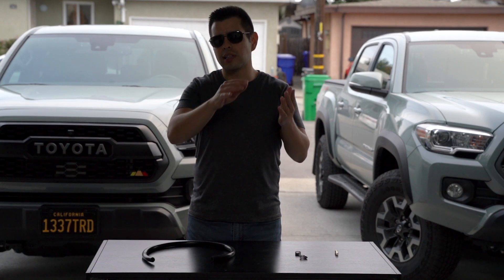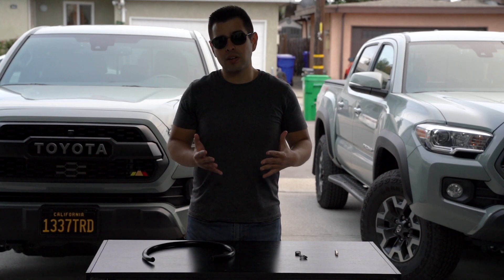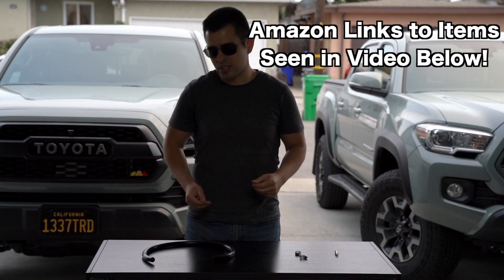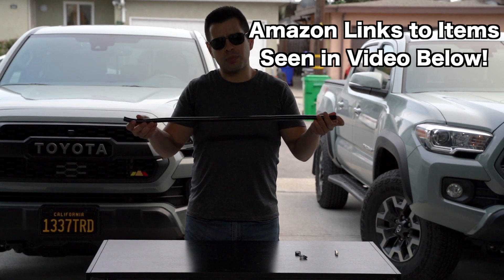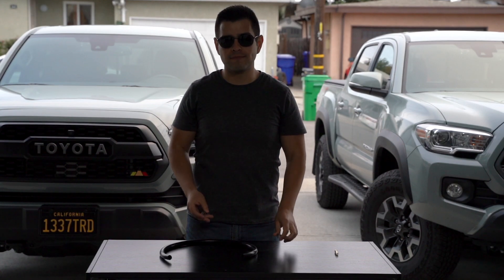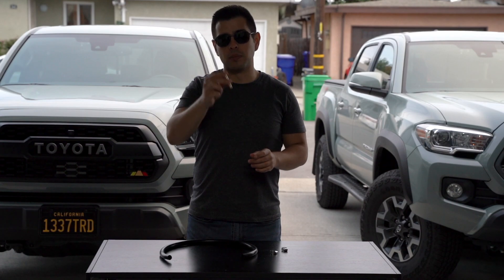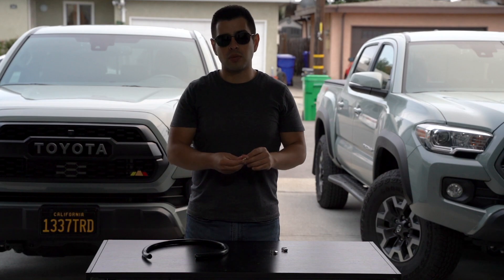What we're going to do is redirect the AC water so it drips away from the frame instead of onto it. You can do this with less than ten dollars in materials — you might even have it already in your garage. I have a 3/8" feeder hose, about two and a half feet, two tightening clamps, and a 3/8" barb fitting on both ends. That barb is how we'll connect the hose to the AC drain. Let's go ahead and install this.